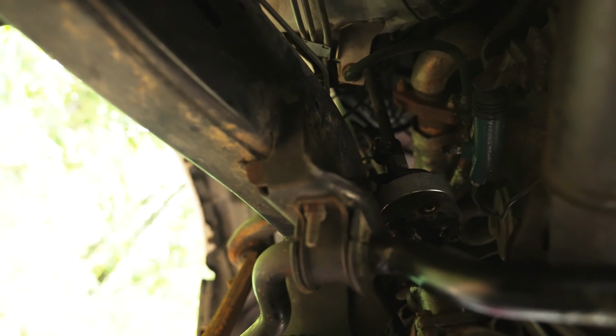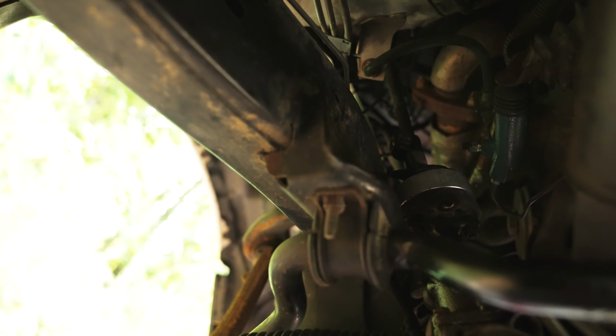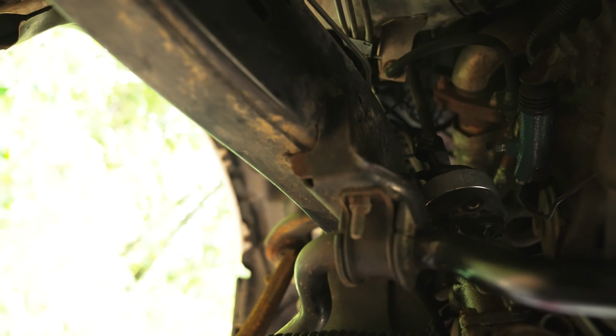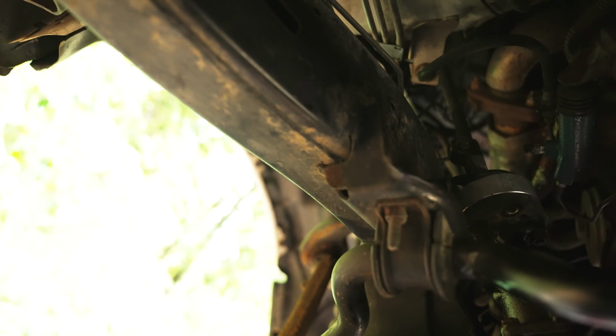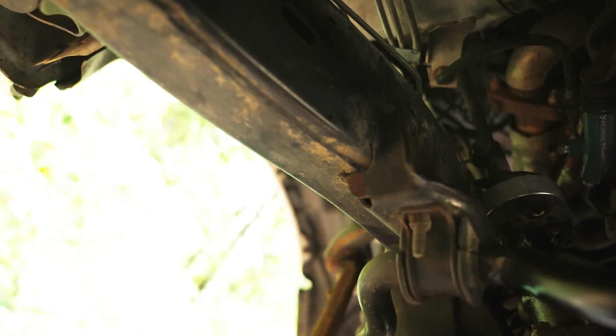The part that's in focus that looks like a shiny silver puck, that's the steering column coming down into the power steering rack. And basically I had to take out the two 12mm bolts and nuts that hold that together. Now yours probably doesn't have that silver puck. Mine has it because I have a 1-inch body lift on this truck. So that's the 1-inch spacer for the steering column.